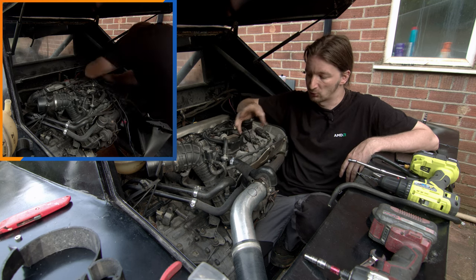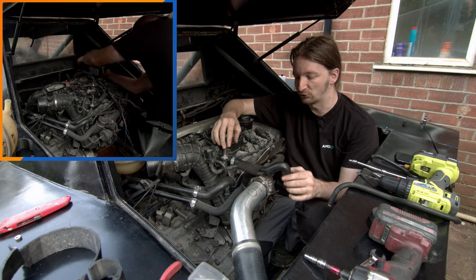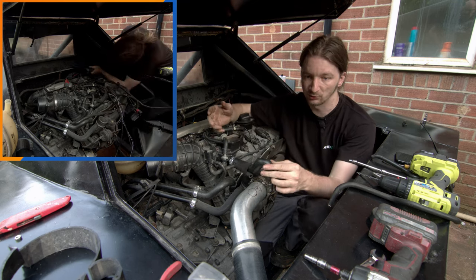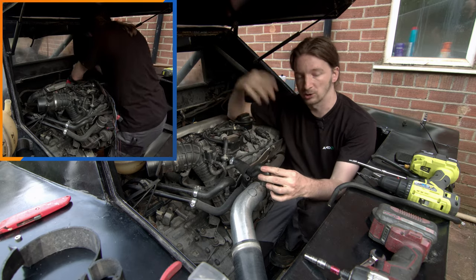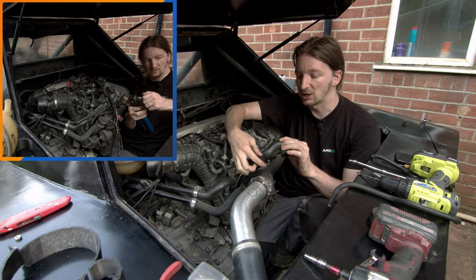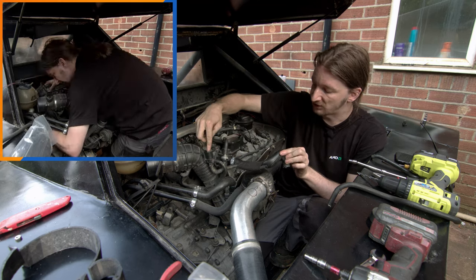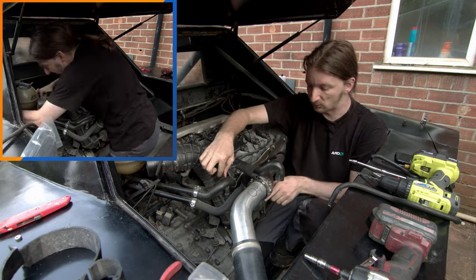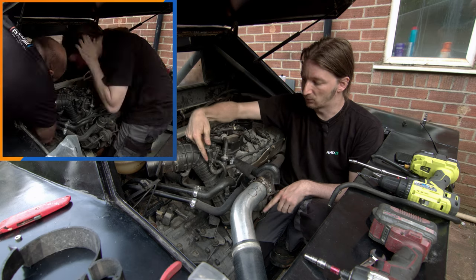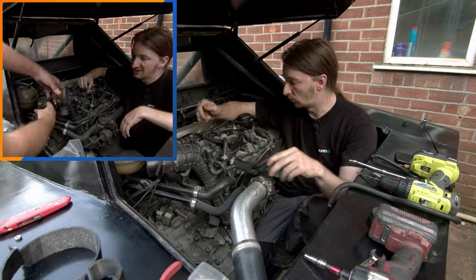We've also dug into some of these coolant and boost lines. We've marked out a couple of holes on our boost pipe here where we need to drill and put some bosses on. I think this one is recirculation — so when we have an overboost condition, the turbo has spun up making boost, you close the throttle, and this little recirculation valve lets it back into the intake. And I'm guessing this one here is boost reference, because that goes into the bottom of the little solenoid on the other side, which is connected to the wastegate actuator. So we get boost reference pressure in here for our wastegate control solenoid, recirculation here — we just need to put a couple of barbs on here and here and that will all be good.